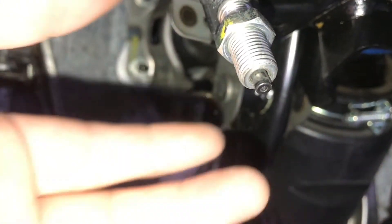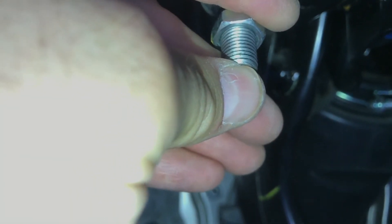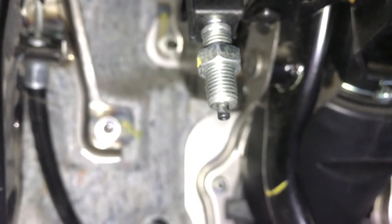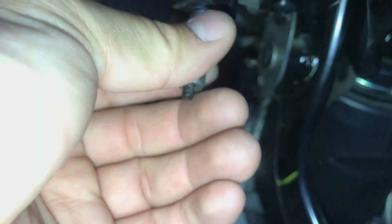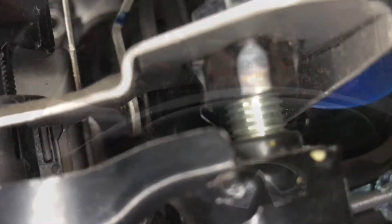Here's the switch that needs to be continuously pressed by the brake pedal to complete the circuit. When the circuit is released, that's when it knows to stop the cruise control. What I had to do is pull this off so I can break the nut loose and then adjust it so it's properly engaged by the brake pedal.